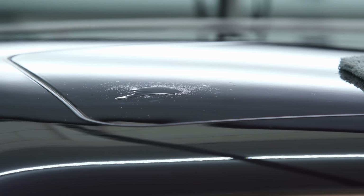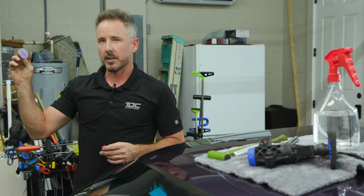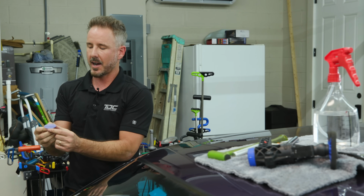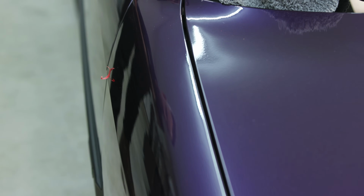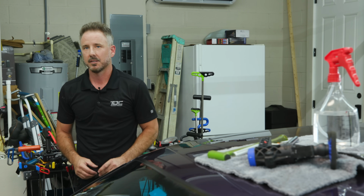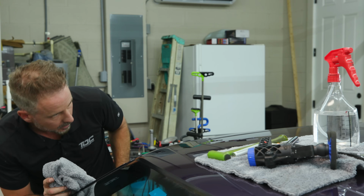These guys right here, any dent guys that are watching who have never used them and thought they were junky, these are like the very first type of tabs we ever had. What they do is create almost like a suction cup vacuuming type of hold. You could put two here, boom, boom, as long as it's completely polished and really set up for adhesion. You could hook onto them and I would bet you could start to rip the fender off. You could pull the car, you could move the car. That's kind of where it's getting to with some of the stuff we're using.